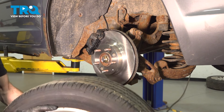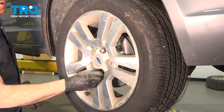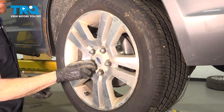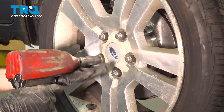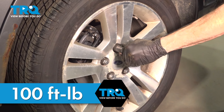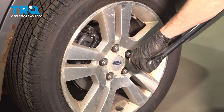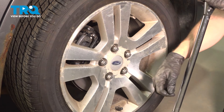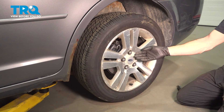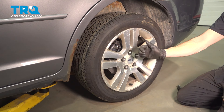Let's give this one last inspection and reinstall our wheel. Continue on to all five of your 19mm lug nuts — bottom these out, get the wheel safely back down on the ground, and torque each of them to 100 foot-pounds in a criss-cross manner. We showed you how to replace one side of your rear brakes on your vehicle. The process for one side is the exact same thing as the other. Once you've completed that, go ahead and pump up that brake pedal until it's nice and firm. Take your vehicle for a road test and listen for funny noises.